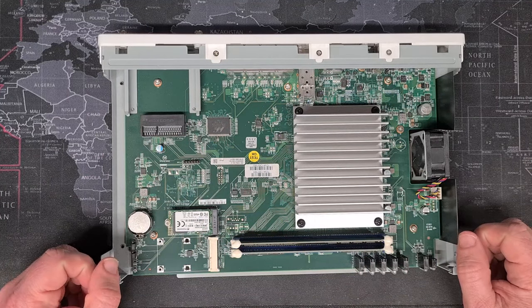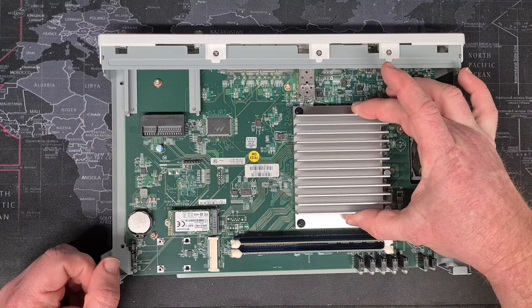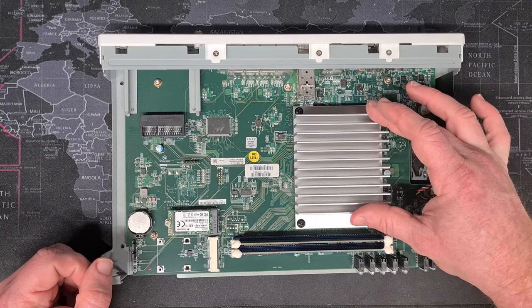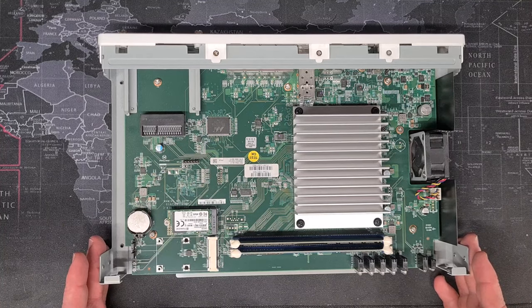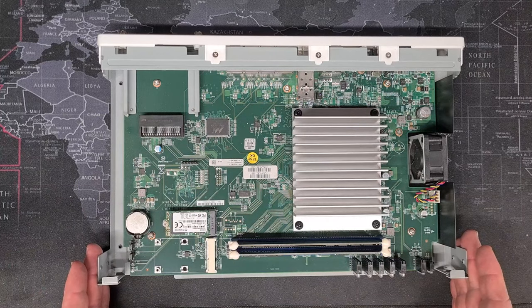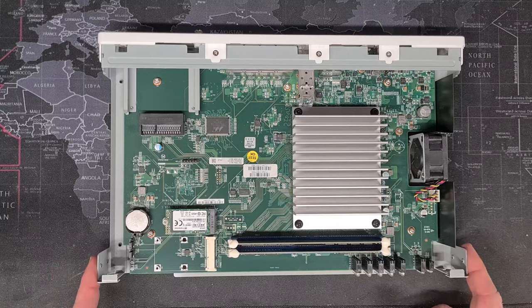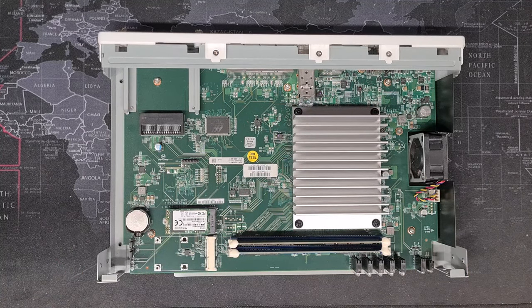This is effectively the inside of a firewall, and it's not much different to any other x86-based hardware appliance firewall. It has a standard processor, soldered onto the circuit board. The 200 and 300 series firewalls actually have changeable CPUs — they're just standard Intel CPUs and can be upgraded if you feel like doing so. But for what we're looking at here, this is absolutely fine.